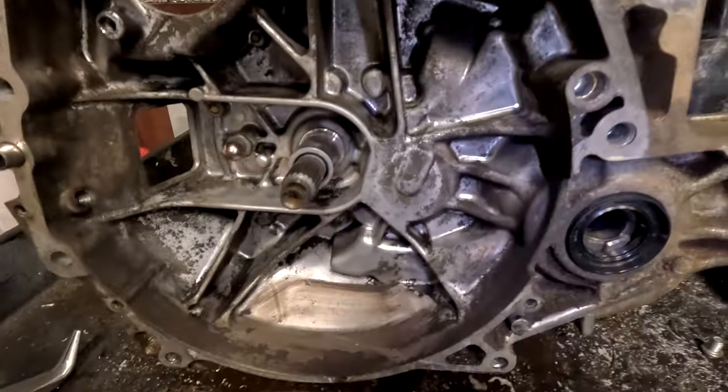For the seals, I got National Seals. The 315 number is the left side, which from inside the car looking out towards the front means driver side. And 630 is passenger side. You're going to get this seal kit from AutoZone — just rent it, number 57119. You're going to use the letter E, and that will line up perfectly. To do this, hold it completely perpendicular — straight in relation to the transmission. Tap this side with a hammer and slowly get it in until the edge here is flush with the case. Make sure you remember to lube this up with a little bit of the same grease you're using for the shift fork, just so you don't rip the brand new seals when you put the axles in for the first time.